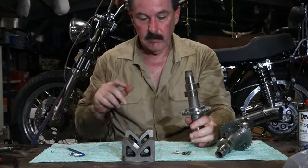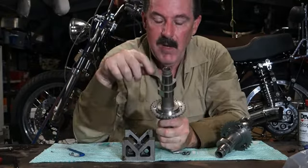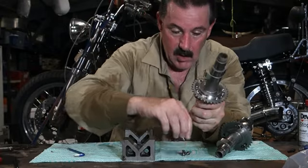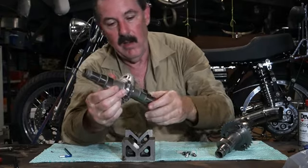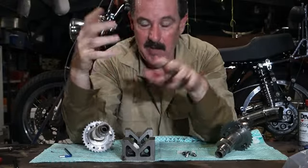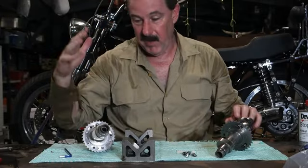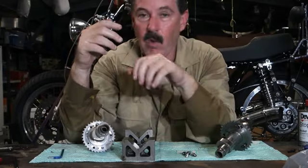All right. Now, while I was about that, I thought to myself, wouldn't it be nice if you could change the cam timing without going through the whole process of putting on the degree wheel and the dial indicator and all that other stuff again? Now, as I said, this is a pretty hot cam for a street engine, and we know that changing the cam timing doesn't make any more power, but it does change where the power comes in the rev range, right? So if you advance the cam, that lowers the rev range where the power comes on. If you retard the cam, that lifts the power up in the rev range. I can't imagine that I'd ever want the power to come on higher than it's going to, but I may want it to come on lower.